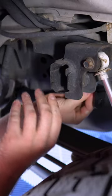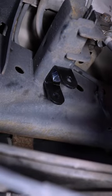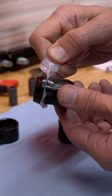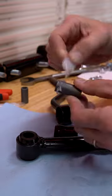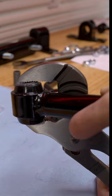Install the threaded plates inside the rear shock cross members. Then attach the clevis to that threaded plate using the bolts provided. After lubricating the hourglass shaped bushings with the supplied lubricant, insert them into the end links, then install the metal sleeves. This is where we use the joint pliers to get them in there.